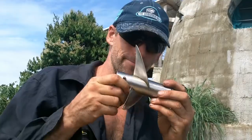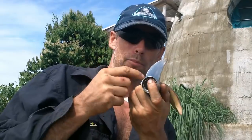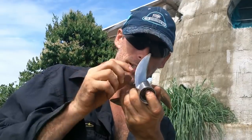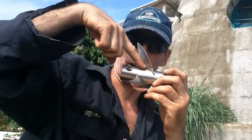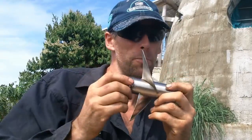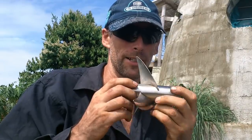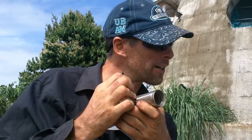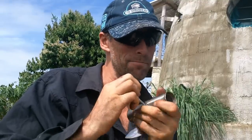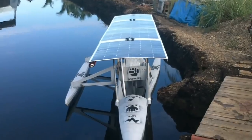Now for this propeller — there's a pipe inside that gets smashed in and presses against the tabs at the bottom of the blades that are folded up, locking it all together. When I smashed that pipe in, it bent the propeller blades back further than I wanted. I was hoping it wouldn't really matter, so I just tried it. Now I'm thinking maybe that mattered more than I was hoping. So I took my vice grips and cranked them forward to bend the blades. I didn't want to do that because I didn't want to loosen them, but they still seem tight — I think it'll be alright.